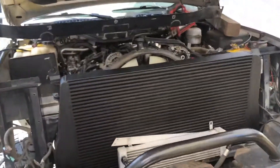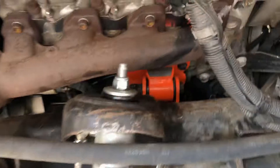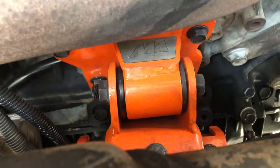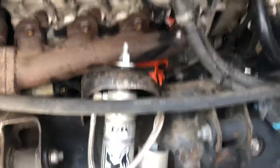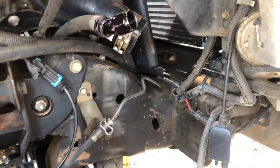That's what they said, and I think that too. So we got Merchant Auto motor mounts, and I also did polyurethane body mounts. The truck is a lot stiffer now — it rumbles a lot more, it's like driving a tractor — but I think that should fix the problem.